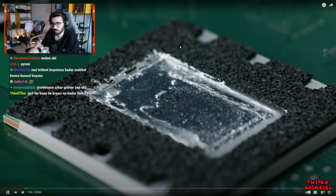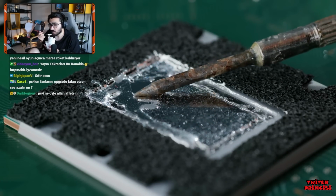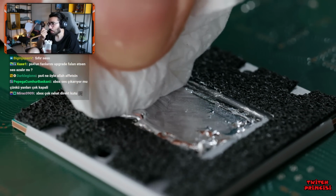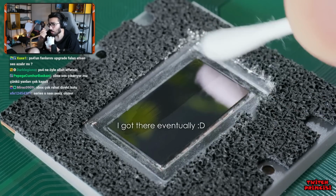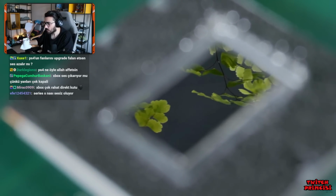Tiny surface area. This is presumably why Sony have opted to use a liquid metal to act as a thermal bridge between the SoC and the heatsink, as it's much more effective at transferring heat than traditional thermal pastes. As it's conductive to electricity as well though, I'll have to clean it off for now so that it doesn't spill onto any surrounding components in the meantime. Shiny.